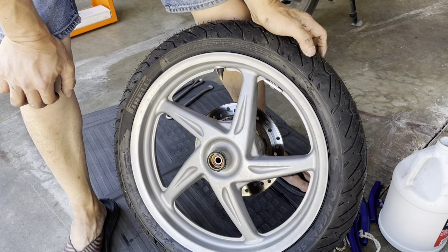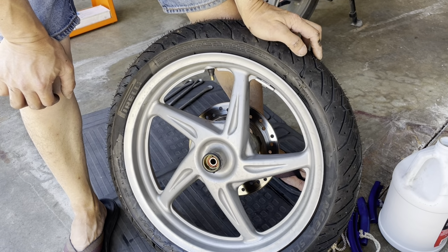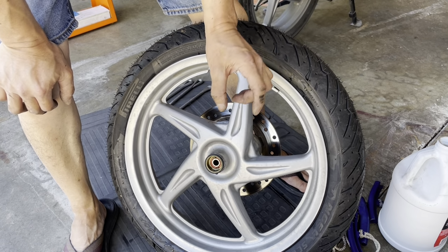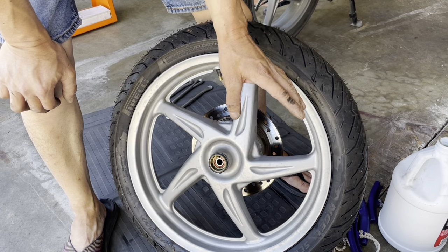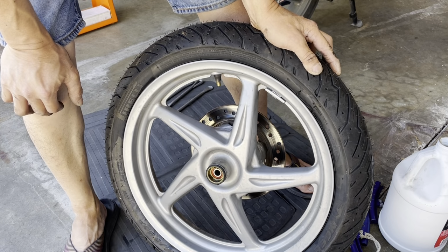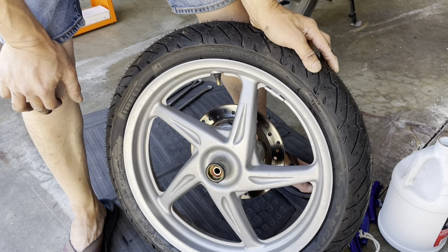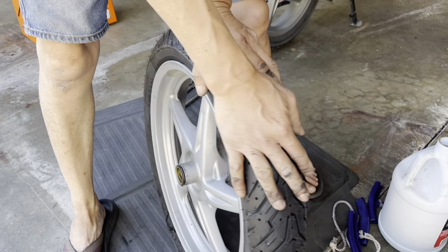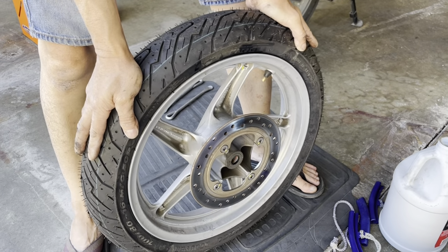And the tire pressure says 25. And that's 25 basically at room temperature, you know, 68 to 70 degrees. I find with tires that for every 10 degrees the tire pressure will change about one psi. So give or take one psi. So this tire is definitely above 68 degrees right now. It feels like at least 80 degrees. Maybe even more, maybe even 85.